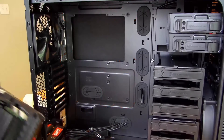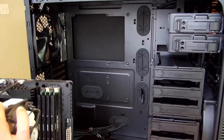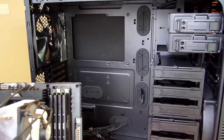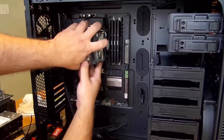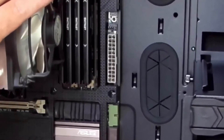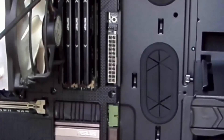If you've never done it before, one of the easiest and best things you can do is hold up your motherboard, kind of lining it up with the IO shield, and look to see if all the holes align. You can see that all the holes align, so this will be the perfect time to screw in everything.